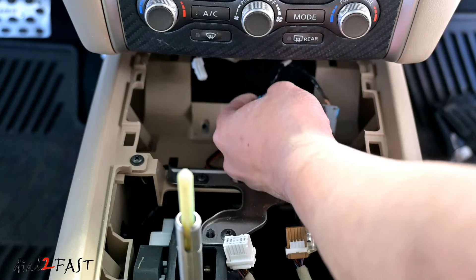I'll first plug in the charge cable from the USB-C port. The bottom of the phone's screen will show you what type of charging it's doing — as you can see it says super fast charging. Here's the charge cable from the USB-A charge port, and here it tells you it's fast charging. So you can see both charge ports are working as they should. This install took me about an hour, and now I have updated USB charge ports in my car.